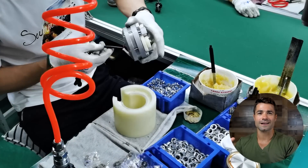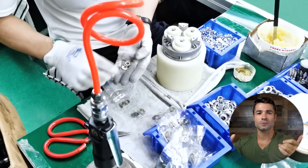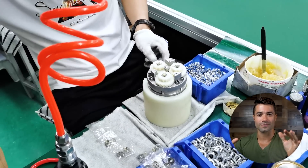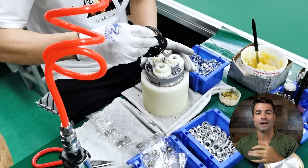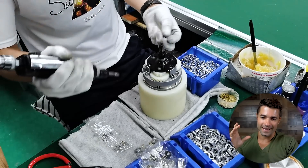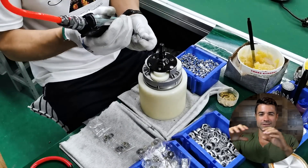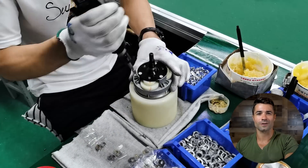Moving on — if you look on the other side of this motor housing, we've got some new pieces: those are the planetary gears, and that's for a gear reduction. In the last clip the motor was spinning at over 3,000 RPM — healthy for motors of this size, but way too fast for a bicycle. So to get more torque and low-end power and spin at a reasonable rate, those gears are installed. The motor spins, gets reduced through those gears, and the end result is a motor that spins much slower but with much more power — ideal for a bicycle.